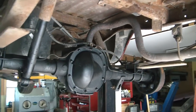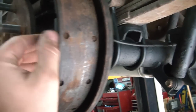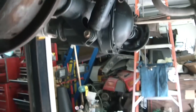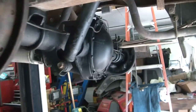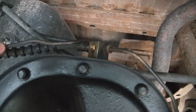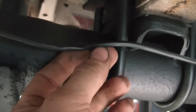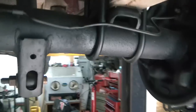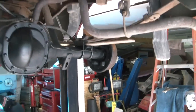I got this axle up in place, and I think I'm going to leave the pads — they look pretty decent, there's a fair bit left to them. What I am going to replace are the wheel cylinders and these lines, because this one is broken.